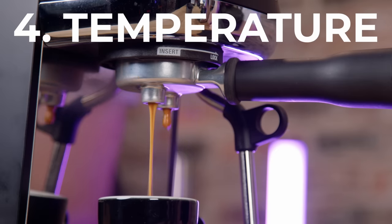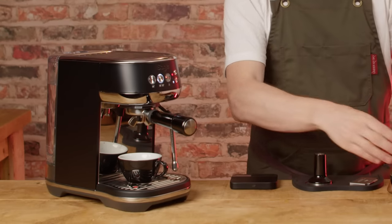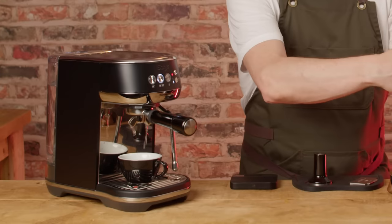Fourth, temperature. Temperature stability relates to the ability of the machine to keep the brew temperature consistent. With single-boiler or thermocoil machines, it's important that they can take the temperature up to steam temperature and back down to brew temperature and hold it there. Nearly all entry-level espresso machines struggle with this, including some higher up the price list like the Gaggia Classic and Rancilio Silvia. Having a PID — a temperature controller — means this machine is impressively temperature stable. It isn't perfect because stability is in the heater itself and not the group, so there's a bit of user interaction required to ensure the group and portafilter are also up to temperature.